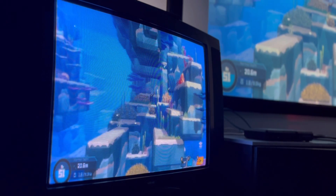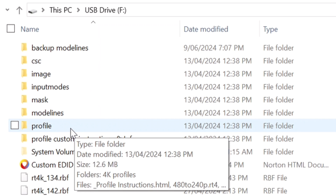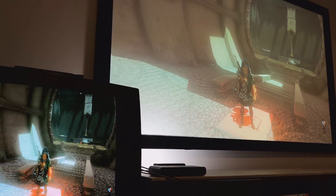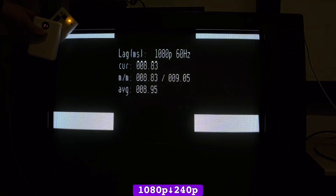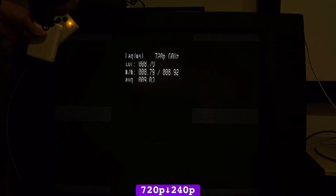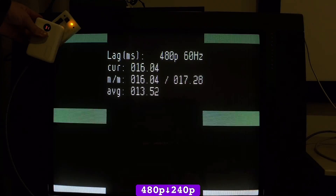If all of this seems a bit much, I've provided a link to the 240p mode line and profiles. Simply copy the files to their corresponding folders on the SD card and assign the 240p profiles to any number on your remote. Keep in mind that I've stretched to fill a 4x3 height and that no CRT is scanned the same, so you'll likely need to optimise some menu items on your display. With the default buffer mode, downscaling any input resolution to 240p is a variable 2–19 milliseconds, which translates as high as 1.2 frames of lag, and I've found that the lower the input resolution, the faster the lag varies.